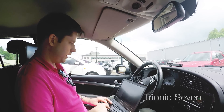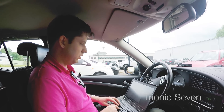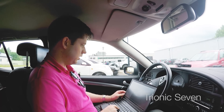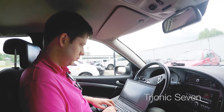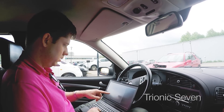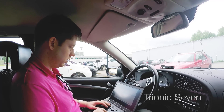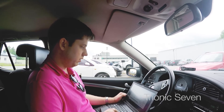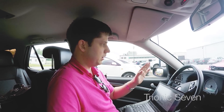We have to modify the VIN number and anti-theft codes, but that's all easily done. We're going to copy the codes from the stock binary of this car to the 55P binary from my aero. Everything should work because that car is also converted to use ethanol. We paste, then copy from the stock binary the chassis number or VIN and paste. We open city info and enable the second lambda sensor. Now we have the binary file we want to upload. Always when flashing we should ideally have a battery charger, but I have a spare ECU in the trunk just in case.